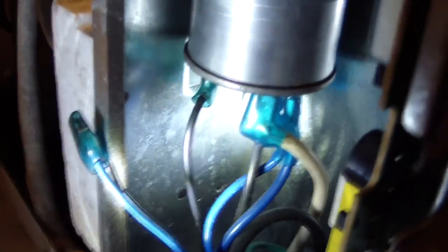When you get ready to disconnect your electrical, you're gonna find two spots that come in. One's black, one's got a fiberglass cloth around it — the fiberglass cloth is the compressor, you don't want to disconnect that. You're gonna have the blue wire which goes up here on this capacitor — it's already off. Wear gloves when dealing with capacitors because it's just easier discharging them. The red goes on the back of the board, right behind the little relay. And then the ground goes in the back, right there in the center.